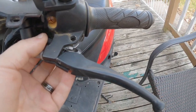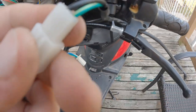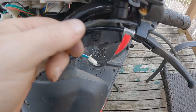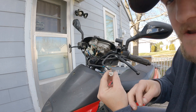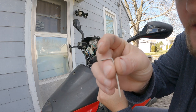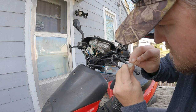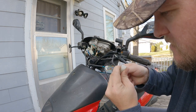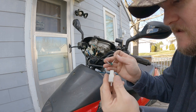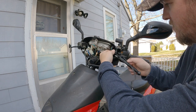This brake switch you should be able to push it out like that. I'm going to pull those connectors out of there — I'm going to use this little allen wrench to get down in there and disconnect them, just like that, and guide it off. Now all I have to do is pull this wire out, just like that.